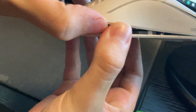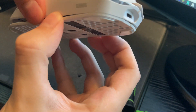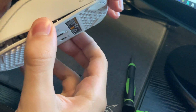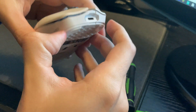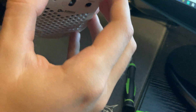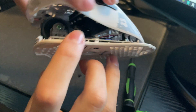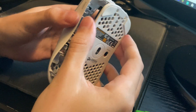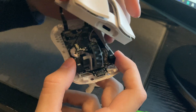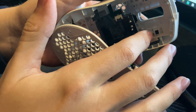That's what the first clamp looks like — it's holding it together, and there's going to be another one on the other side. The front ones are the ones I had the most issues with. This mouse is also decently delicate, but it's pretty easy to get apart. As you can see, there are two clips in the front — one here, one here — and the back. You don't really have to mess with the switches, as that's not exactly the problem. The problem is right here where the plastic is meeting.